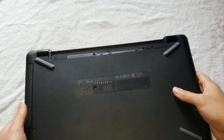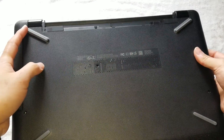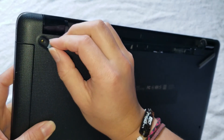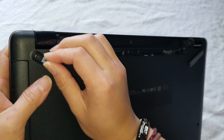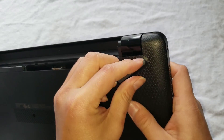Once you do that, you want to remove all the screws. There are four hidden screws on this model under the corners of these rubber pieces, so you'll have to move them aside. You can use a needle if you can't pull it up, or something like a flat head screwdriver. There's one under here, and then there's two here, and there's another one under this corner.